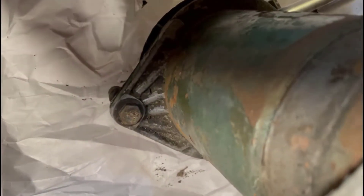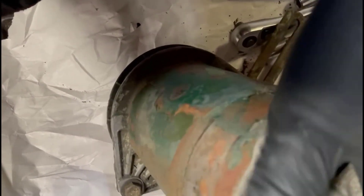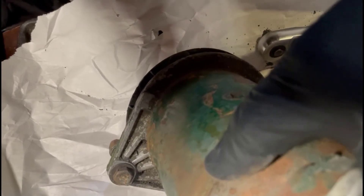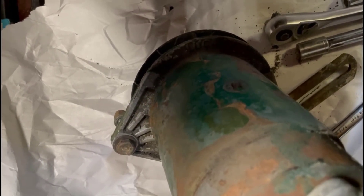What else is interesting is you can see that same color — the real Morris green — underneath that very bright green that someone resprayed the engine with. And there's this hip, this little hip in the body of the generator where the coil bracket rests against. That's kind of interesting, and I want to keep this generator rather than just replacing it, and see if we can add some new brushes to it and get it up to speed.